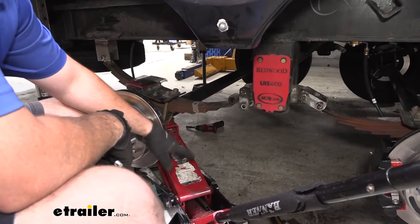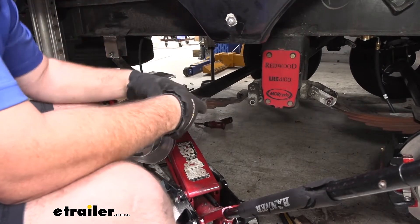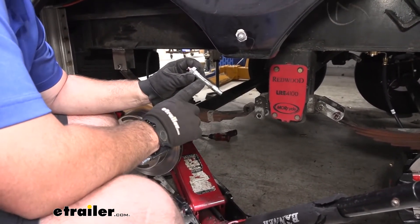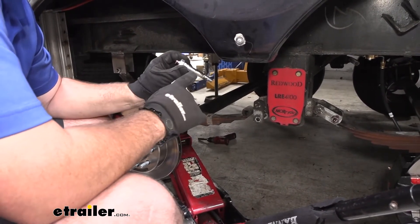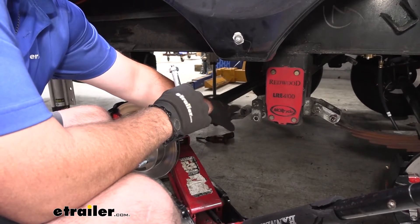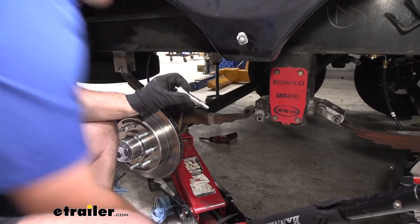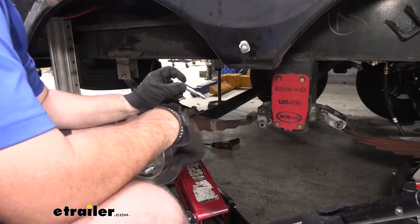To start your installation, make sure you have a jack underneath your axle and remove your wheels. You're going to need to take out your shackle bolts. When you take these out, clean them off — especially if they have a zerk fitting, there's going to be a little hole in it. What I found is they were clogged, so when you go to grease them, grease wasn't coming out, and that breaks apart the sleeve inside. Make sure you check these, run a little bit of grease through there and confirm it's coming out of that hole. If it doesn't, take a pick, clear out that hole, squirt some grease in, and clean it off.